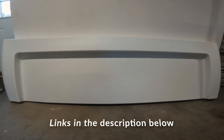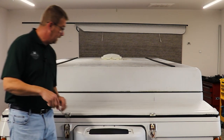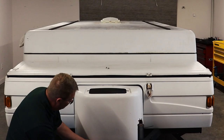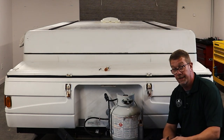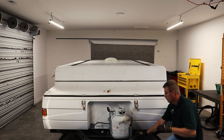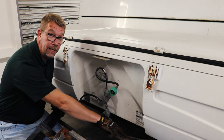We're going to replace with this front body panel. The battery's already off the camper, so next we're going to remove the LP cover and the LP and disconnect the propane. A flathead screwdriver takes this system off. Use gloves for the wing nuts on the bottom of the J-hooks for your LP bottle. Disconnect the high-pressure line and the low-pressure line from the regulator.